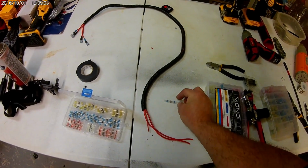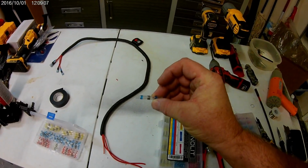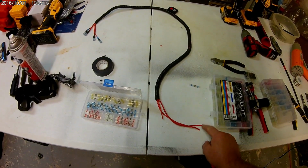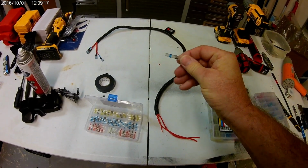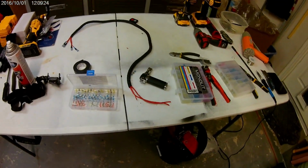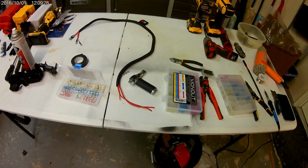And then the outsides, this blue is actually a strip of sealant. So these are waterproof. They're not cheap, so I don't use them very often. But you can take 2 short stripped ends, put them together in the middle. You don't crimp it, you just heat it with this, not a heat gun, one of these torches, and you'd be surprised how quickly you can seal those units up in place. So that's how to do it quickly.